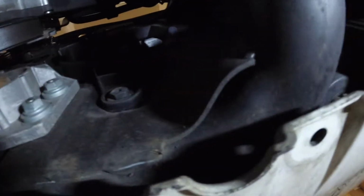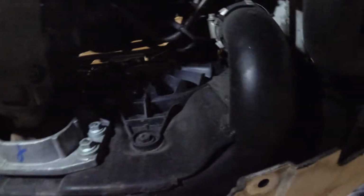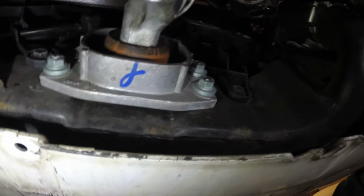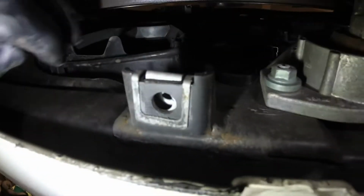Alright. Here. Good luck under here. Where's the big light? Here, I'll take this light. There's the big stand-up one somewhere. Oh. Okay, let's take a look here. What do we got? See an engine right here. This is the front of it. Looks like we got an oil leak out of the drain plug there. Don't see any other leaks there. This front funky engine mount thing, the rubber's starting to go on that. We'll have to do that maybe one of these days. Belt looks alright.